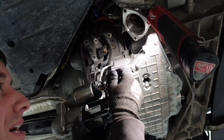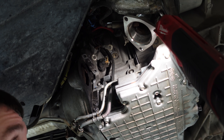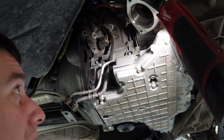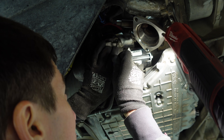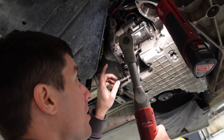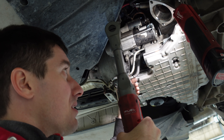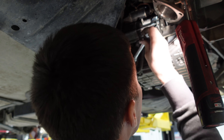There's a little purple wire — that's your actual starter control. And then all the other wires: gray and red. If you're doing this yourself, they'll need to land on that terminal so you can just stack up all the battery connections — that's the main battery connection for the vehicle right there. We're going to go ahead and try to hook up the wires first and then slide the starter back up in. It's pretty hard to do this no matter what, because once the starter's actually in, you don't have a lot of access to the terminals. Buttoning up our dust cover there. This clamp here also holds the lines on to the transmission cooler, so I'll get this tightened down. We're done on this side of the engine — totally done.